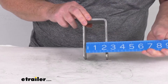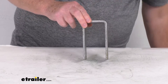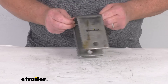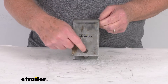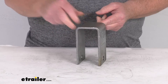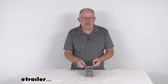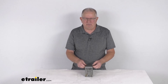You can see if we measure the inside where the slipper spring goes, there's about two and a quarter inches, so it allows enough room for the slipper spring to fit in there. It is designed to work with a 9/16 inch diameter bolt — that's the diameter of the hole here — and that bolt we do sell separately on our website. That should do it for the review on this four and a quarter inch tall front hanger for two inch wide slipper springs with the 9/16 diameter bolt hole.